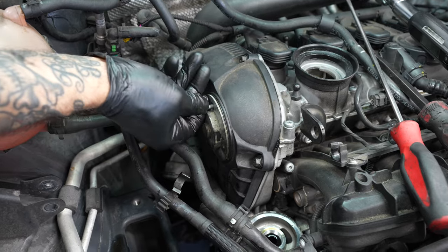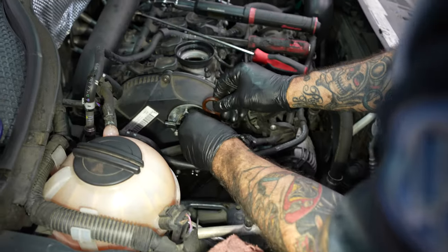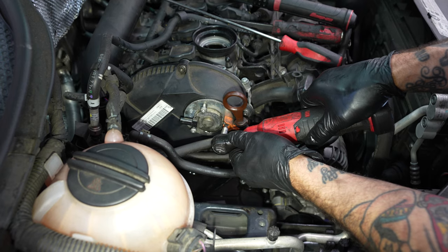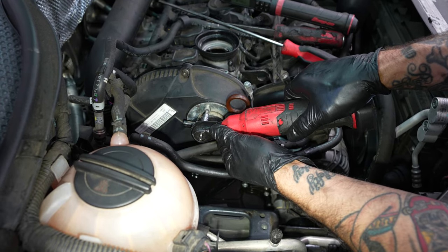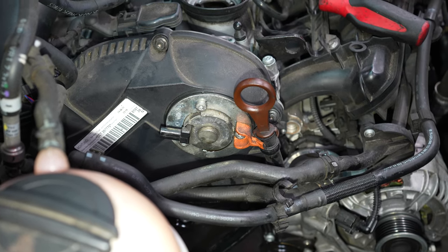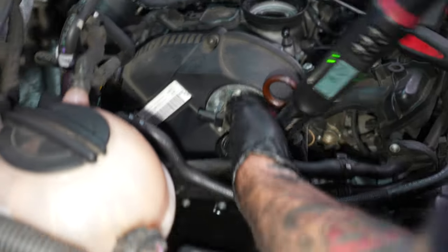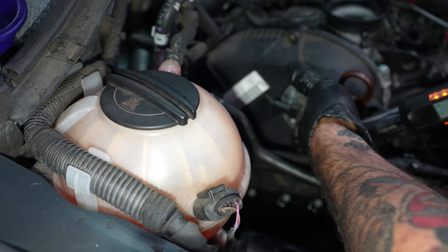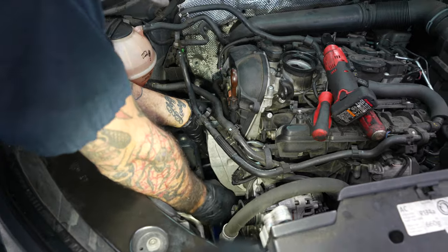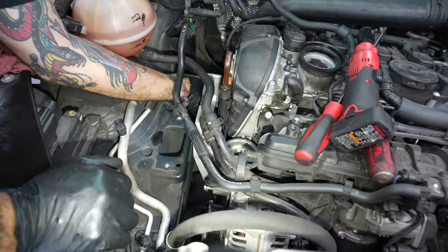Installing the cam magnet, and then the steel one for the dipstick accessory. All three bolts are the same — 8 newton meters. And then the engine mount bracket — three triple square 12s. Sounds crazy, right? Three triple twelves.